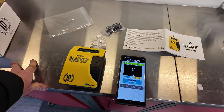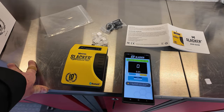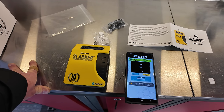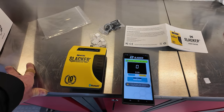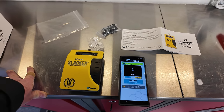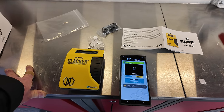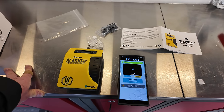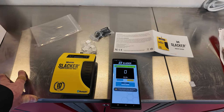Now I've looked up in the owner's manual for my bike, and you make sure you're looking at your manual, not something you saw online, it says 110 millimeters of riding sag. That means the bike sags down 110 millimeters from being completely unloaded with the shock fully extended to you sitting on it in your riding gear, helmet, boots, camelback, everything, tools loaded on the bike. Most people have too much sag because they're overloading their spring. So we're going to go out and do that, and I'll try to film it while I'm doing it, but it's kind of hard.